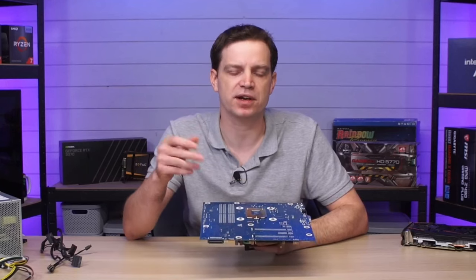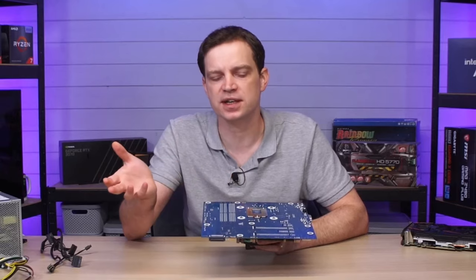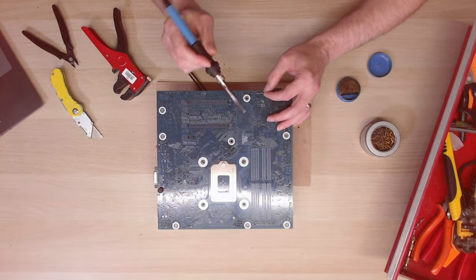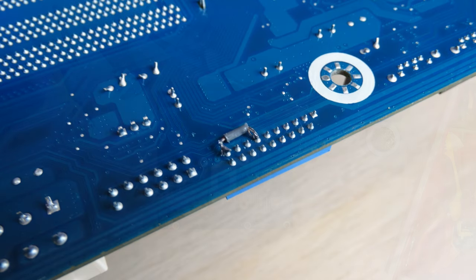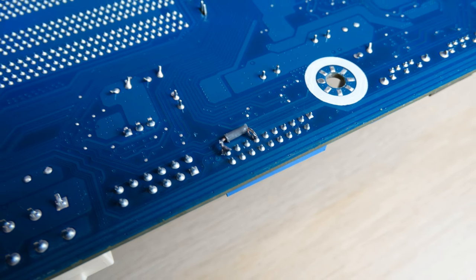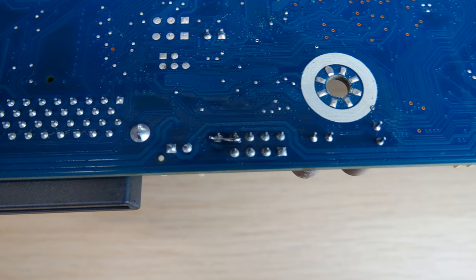A lot of guides out there will show you how to splice the wiring inside your new case to make it work, because all you need to do is jump a couple of the wires. But we've gone a little bit more extreme because it's technically a problem with the board - I don't want to butcher a brand new case just to get this to work, particularly if we want to swap it into another case later on. So I've decided to fix it on the board by actually soldering two little pieces onto it that bridge the exact points we need. This has been tested on our test bench and it works perfectly fine. If you want more information about that, jump into our Discord server and I can share the diagrams I used - there is a link in the description below.